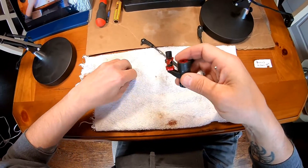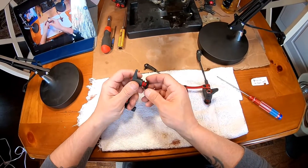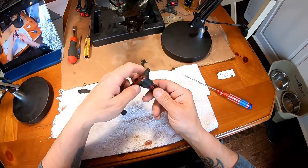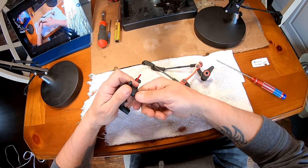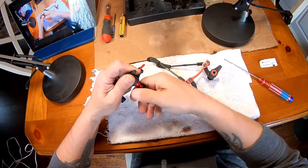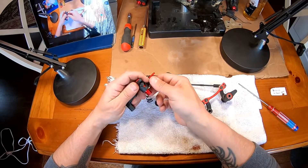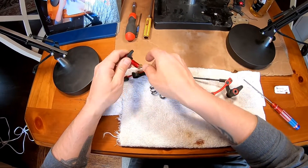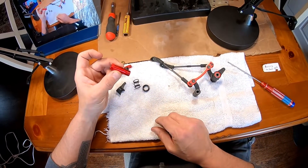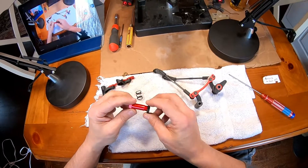They're not the only company that uses bushings, but anyway. To solve the problem of the nut backing off while running, they came up with this new design. Taking it apart, you've got this collared nut, your spring, the bottom half of the servo saver, the top half of the servo saver, and then what they call the hub. That's everything in between, and this is how you adjust the tension — and 'adjust' is the key word we're getting to.